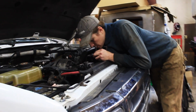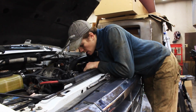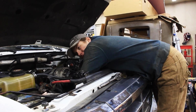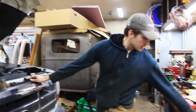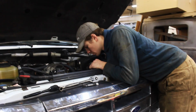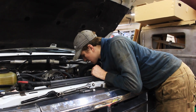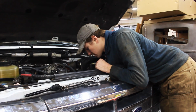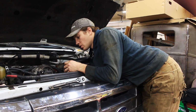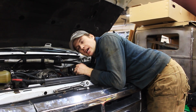Okay, so I just started wrenching on the harmonic balancer and it started coming off quite easily. I do have the center bolt in there right now, just to get it going. I'm gonna take that out and put the big flat washer back in, and then we will finish taking it off. So at this point, one thing that you can take a look at to make sure that it is actually your front main is this piece right here. This gasket could be where you're getting an oil leak from. That is part of the high pressure oil system, and there's a gasket there. You can take a look when you have everything together, just double check. If it's oily quite up high, then you know it's that one. Although the front mains on these do go often, just because you also have the oil pump as part of that. So just double check to make sure that you have the right gasket. Makes a big difference.